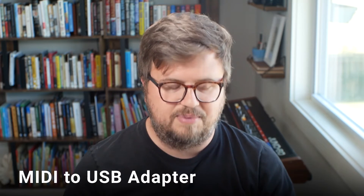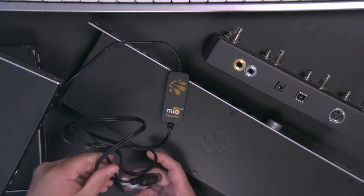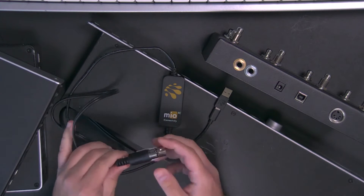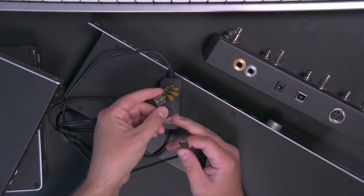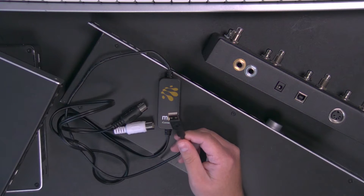But what if you don't have 5-pin DIN MIDI ports on your audio interface and can't afford an additional MIDI interface? There's one very affordable piece of gear: the Mio XC from iConnectivity. On one end it has a MIDI In port and a MIDI Out port. On the other end it has USB-C, so if you're on a newer Mac or PC with USB-C you can plug right in. It also includes a USB-C to USB-A dongle adapter for older computers.